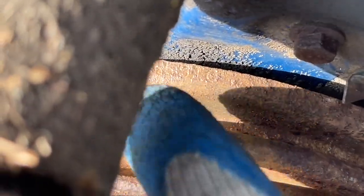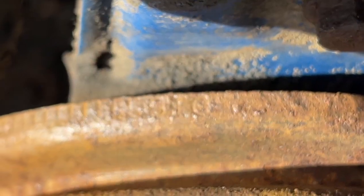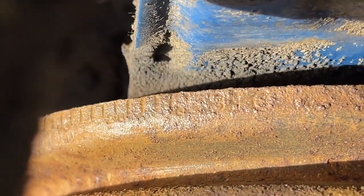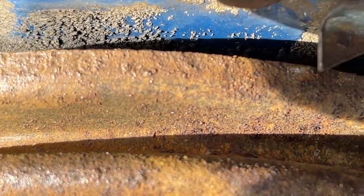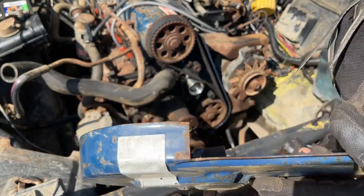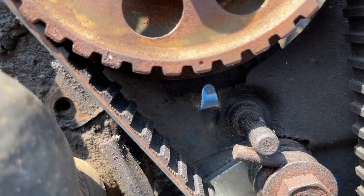But for the crankshaft pulley right now, the first step asks you to put the engine in top dead center. If you do it with the crankshaft pulley on, which is fine, I don't recommend that. I recommend doing this when you want to check to see if the timing is off. You can remove that rubber plug in the timing cover and look through that window when you put it in top dead center to see if your timing is off and you need the belt replaced.